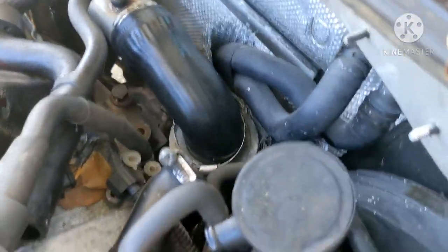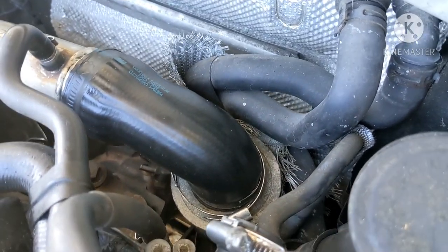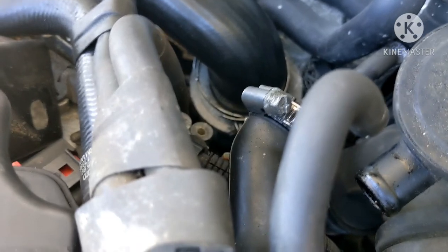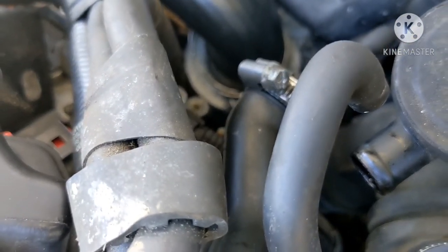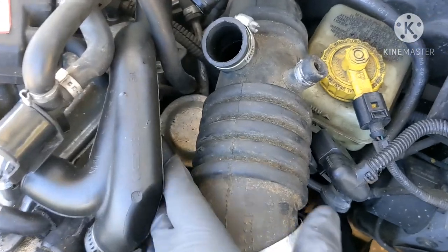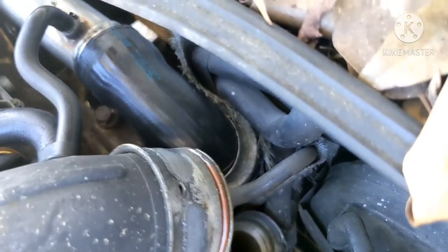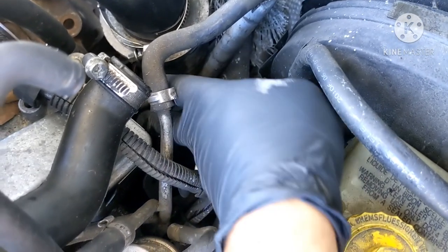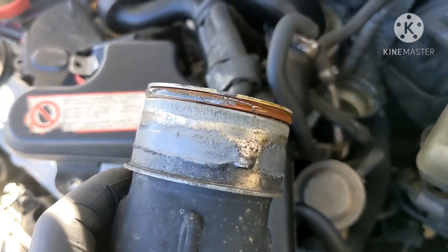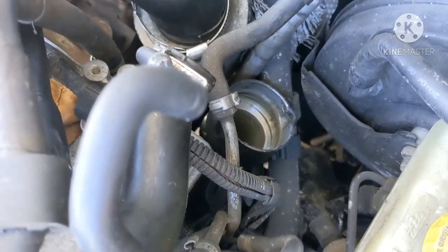For the next part, you might have to go underneath the car. I still have a few hoses to take off on top, but I had to go underneath — there is a 5mm hex bolt that bolts into the inlet, which holds the inlet into the turbo. We'll get to that afterwards. There was a little seal right here that we were fighting against to pull it out, but now we at least have the air box off.